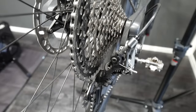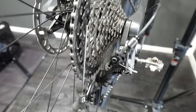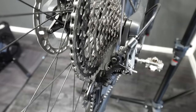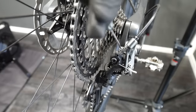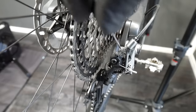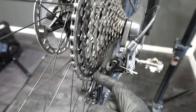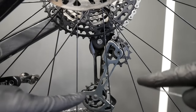Step one: which screw are we going to use? The two limiting screws limit the movement of the derailleur outwards and inwards — those are not the ones. This screw here uses a two-millimeter Allen key — that's the one we're going to use. When we go clockwise the derailleur will go down. When we go counterclockwise the derailleur goes up, closer to the cassette, and that's what I'm going to do. The only thing you have to know is how close the guide pulley should be to the cassette, and at the end I will show you the huge difference between wrong and right shifting performance.